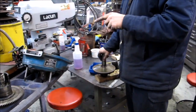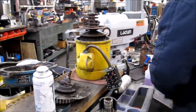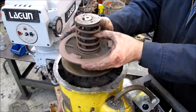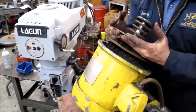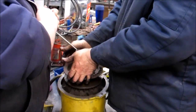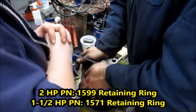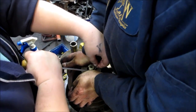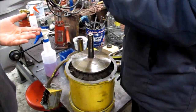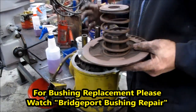I'm going to take the motor pulley off of the motor. Because this one was on with compressed bushings we couldn't use the normal method, so we're going to have to do this the old-fashioned way — this is a two-person job. Get your helper: one person will push the spring down while the other person pops the snap ring. This is more of a circlip on this one, so just let it up loose. There we go — now you have your motor, your pulley, everything's apart. You're ready for your top half reassembly.